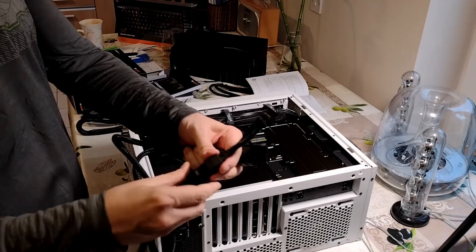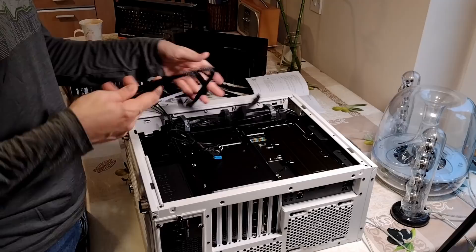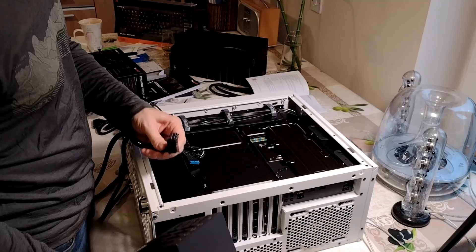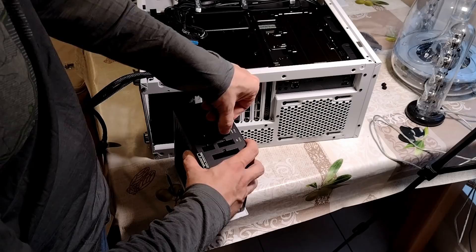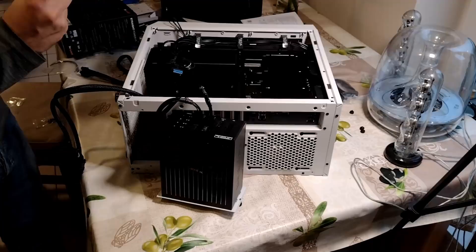That was really smart. At least it gives us more room for now — if you've got more room to fit in the cables, I'll live with it. This is the special connector they give you for an RTX 3080. You have to jam two cables into the sucker — we got VGA2 and VGA3 in there. Plugged it into this sucker which is the NVIDIA proprietary one. Now we have to plug this into the power supply.